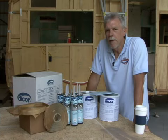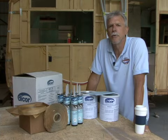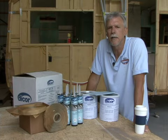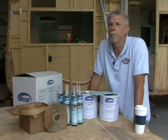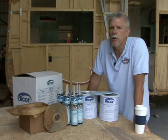Today we give the old Yellowstone a brand new rubber roof. When I made the decision to use a rubber roof I contacted DICOR and within a couple of days the roofing and everything I needed to install it arrived. About 20 years ago RV manufacturers started using rubber roofs on RVs because the material provides a water tight seal, it's easy to install and maintain, and it holds up well against the elements. DICOR sent me a product called BrightPly — an EPDM rubber roofing that's easy to install and maintain. It's highly puncture resistant, has superior tensile strength and tear resistance, and it's both reflective and refractive to UV rays. A big part of enjoying a long life from a rubber roof is prepping the roof before you put it on. I spent a couple of hours yesterday making sure all the screw heads were flush or slightly below the roof decking and sanding any rough edges so that no part of the roof can prematurely wear the rubber membrane.